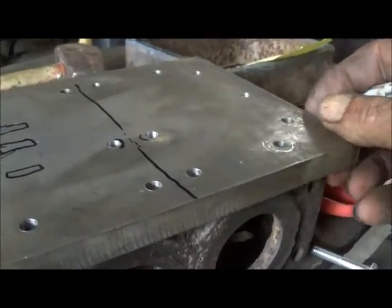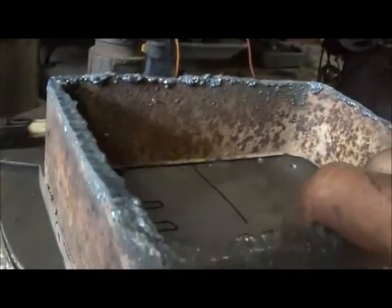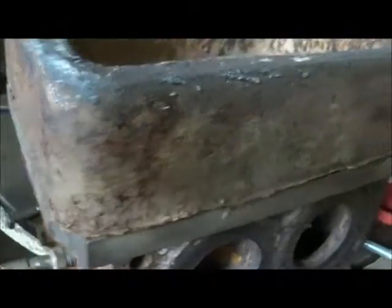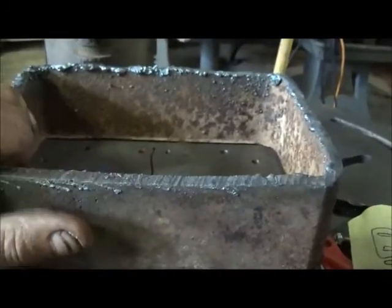Our other piece that I picked up at a buddy of mine's - it's an old rusty piece, but that's what I prefer to use anyway. That'll actually get welded on and we'll get all the corners right, make it all look like it's supposed to be there. We can run our exhaust piece up on here a little bit. This won't be quite that tall when I'm done - I've got to grind it off good before I start machining it. I'll machine it down and get it all flat. It'll work out really good.